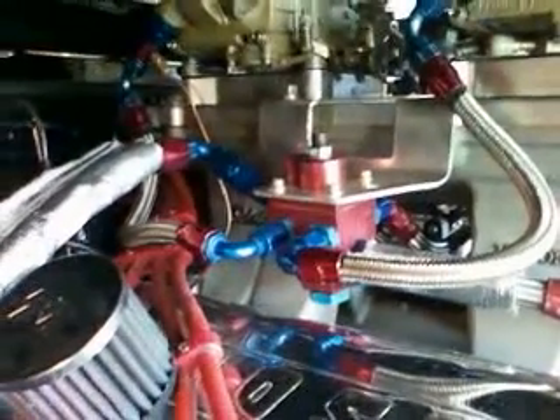Let me get a light here. There's the race pumps fuel pump right there. What I did was I put silver foil tape around it to act like a heat barrier. I also put it on the black block — anything that could soak up the heat, I lined it with foil.